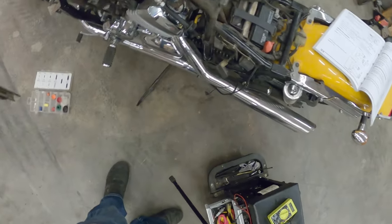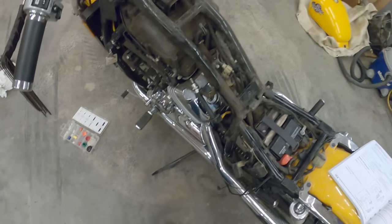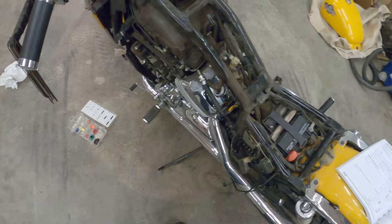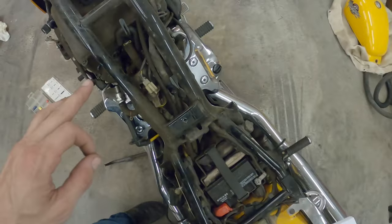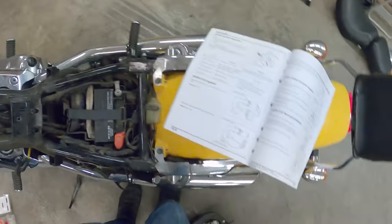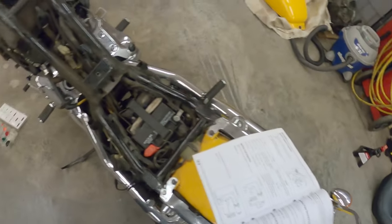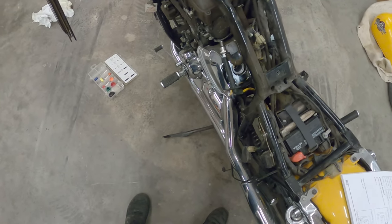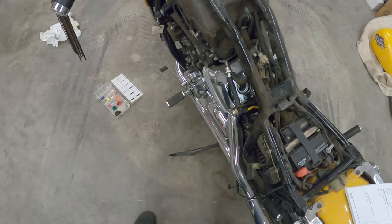The fuel in it, whenever I'd taken the tank off, the little bit that spilled out, it was freaking disgusting smelling. And it was nice and yellow, so the fuel is definitely bad in it. I'd say that's probably the main contributor, because obviously it does have enough resistance where it still has good spark. But yeah, I'm gonna recommend that he still gets a pulse generator for it. We'll get some good fuel on there and see if we can get it to start. If not, then we'll continue on tearing it down, go from there.